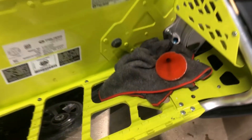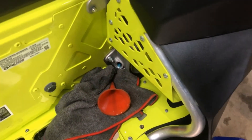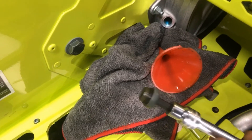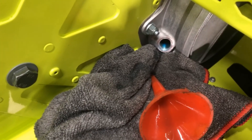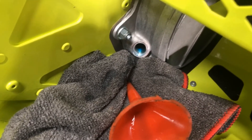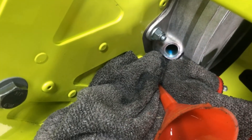The only way to check it is via the little screw right there — that screw goes right into that hole. You pull it out and the oil should be up to the threads. I'm using the Polaris SCL snowmobile chain case lube, and you want that oil right up to the threads.